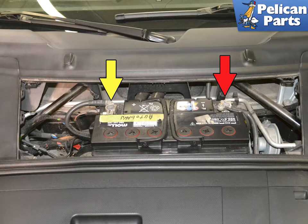Let's begin with replacing the sensor on the number one to three cylinder bank, or the left side. You're going to be removing the alternator to replace the sensor, so you must first disconnect the battery. Do not attempt to move the alternator with the battery connected.